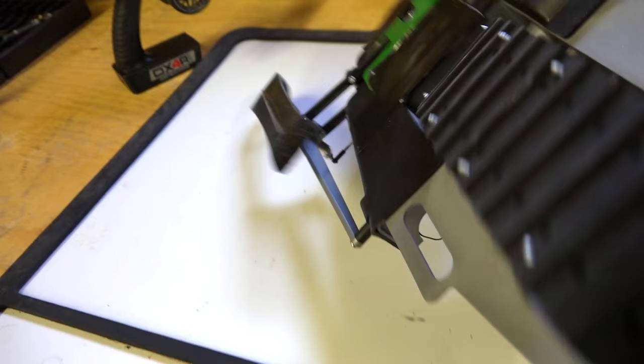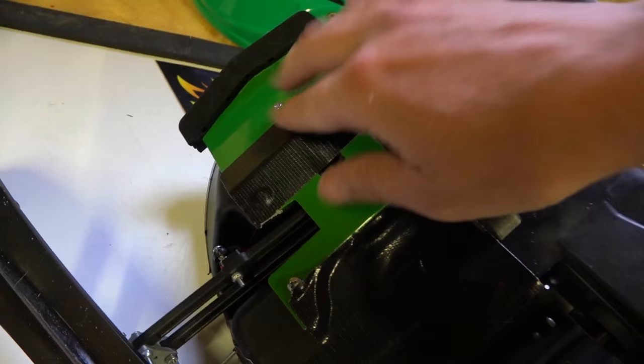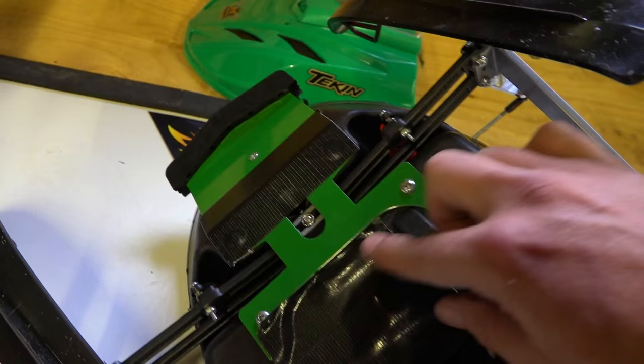Underneath — these are just tips and tricks — and here's that silly Gorilla Tape again. It's almost like my show is sponsored by it, but it's not. Just regular fiber tape. I do this on my big rigs as well. Screws and things really shake loose, so I'll use some Gorilla Tape on the bottom, even on the skid plate area, so what's getting scratched and hurt first is the tape and the screws remain in the spots that I need. These ones I'm not worried about — I've Loctite'd them and they're super tight.